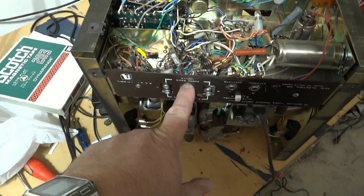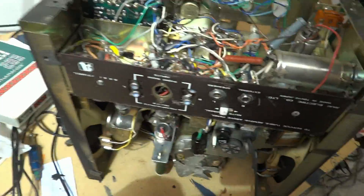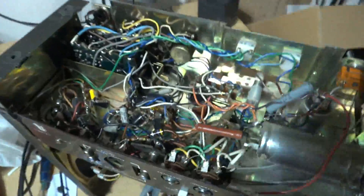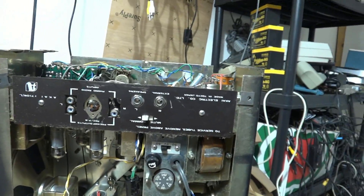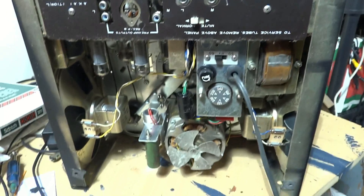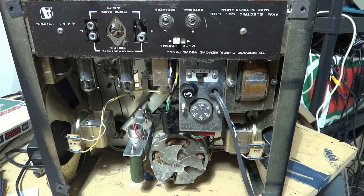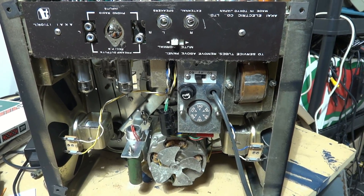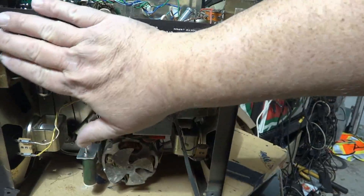There are some problems with it — the DIN jack was removed for whatever reason, so if I want to bring this back to stock I'll have to find a DIN jack. There's a broken connector that a little JB Weld should fix. The phone input is broken, caused by laying this thing on its back, because this is one of those tape decks that didn't have built-in spindle holders — you had to use rubber cups to hold the tape reels on. After a while those would wear out and fall off, leaving tape all over the floor, so it was common to lay the unit down, which breaks the rear connectors.